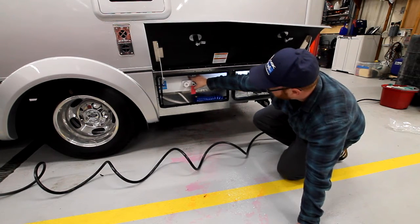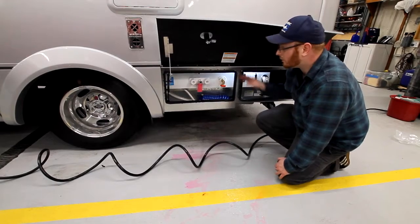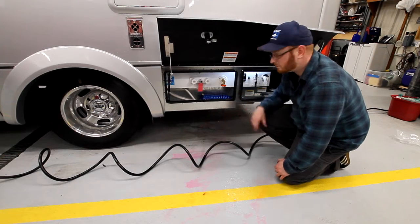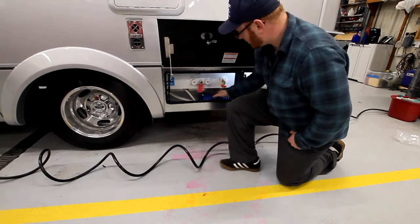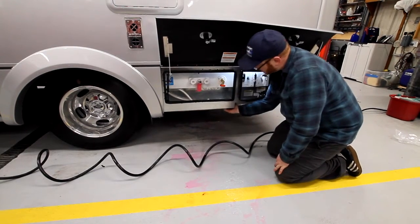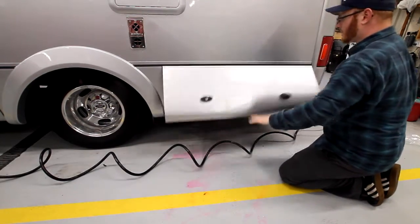That valve up and down puts it back to normal slash city water. This fitting will give water to our city connections, and if we turn on the water pump, it's going to take water from our fresh tank to our city connections. If you don't do that and you turn on the water pump and wonder why you're not getting any water, that's because it's just taking water out of the fresh tank and putting it back into the fresh tank — just making a circle. There is a pass-through underneath here, so you can actually put your hose and cable connection through there to close this compartment, keeping water out of your unit and making it look nice and clean.